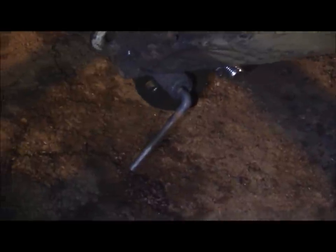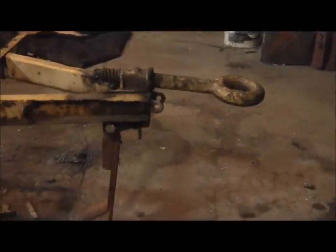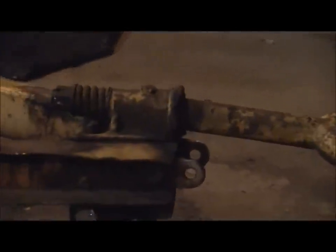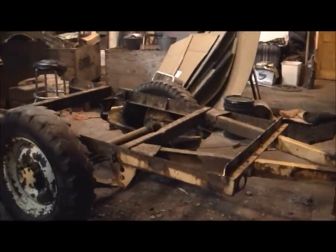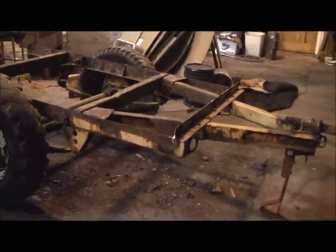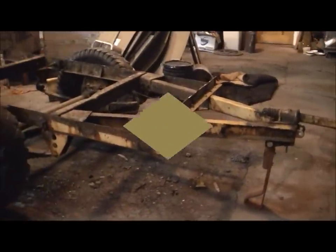Here's a quick picture of the leg pin to drop the leg. Most customers get a little confused when I send them a straight part, but after you've installed it, heated it, and bent it over, that's what it looks like — that's what everybody's used to seeing. All right, we now have all the components working: we've got a functioning leg that comes up and down and a lunette eye that's now loose and spins around. We've got the body off, the shocks off, and our rear cross member won't be ready for two weeks from the fabrication shop. So we're ready to take this down to sandblast, get it blasted and painted, then put the rear cross member in and go back to putting the body on.